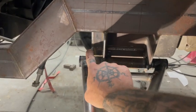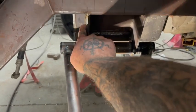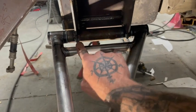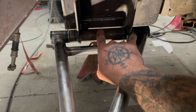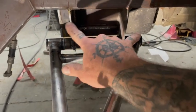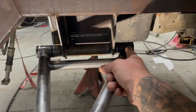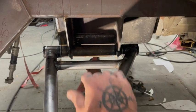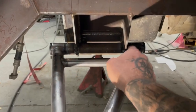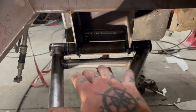Okay, so this is what used to be the face right there. You can see I notched this back about like 1 3/4 inches. And then I built this support tube. So this just has a couple threaded inserts that I spun out, and then a piece of DOM in the middle. Just the bolts will go straight in that, thread into that. They'll keep all that stable. It also gave me the opportunity to make this double shear. A lot of time on a Mustang 2 style, they'll have something hanging out the back with a gusset welded in there. This one's wider than what a Mustang 2 would be anyways. They're normally yay big, but when I designed this one, I added a tail to flare the back out to give it a little bit more control.